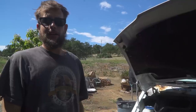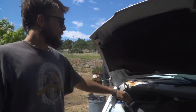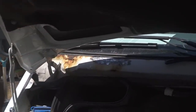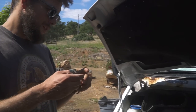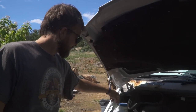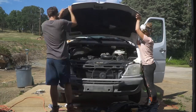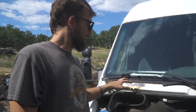We've been sanding for about a good two hours now and it's time to address this rust under the windshield. So we're going to take the hood off — it all just comes off with the number 13 wrench. There's a bolt here and then there's two bolts on each side. We're going to remove this and it'll make painting the hood easy as well. So we got the hood off.